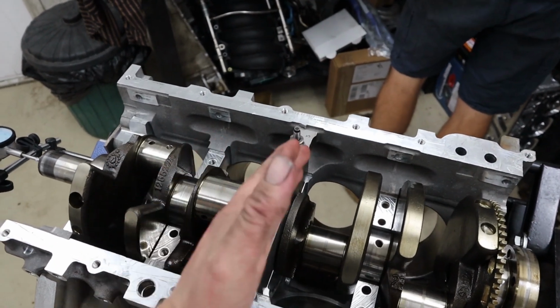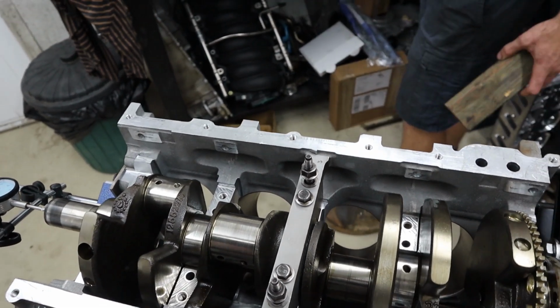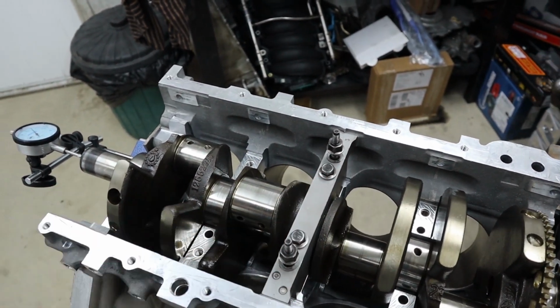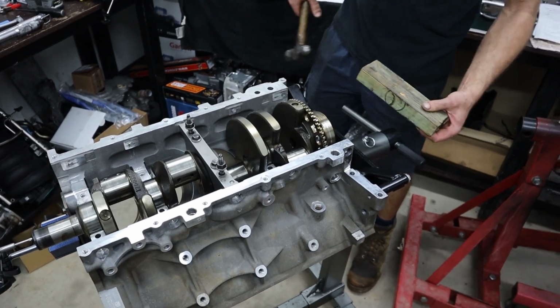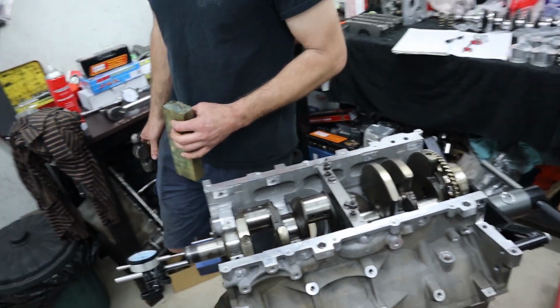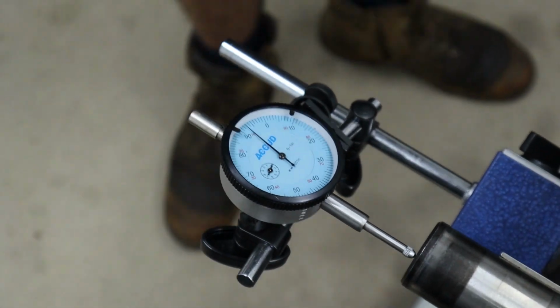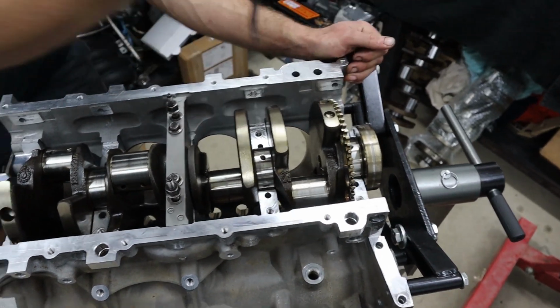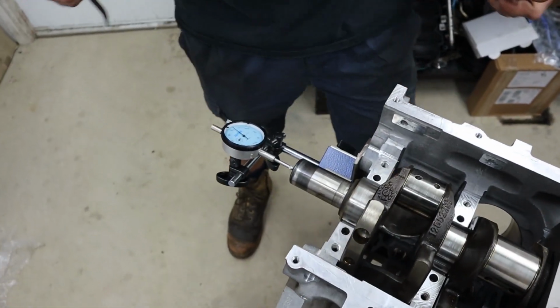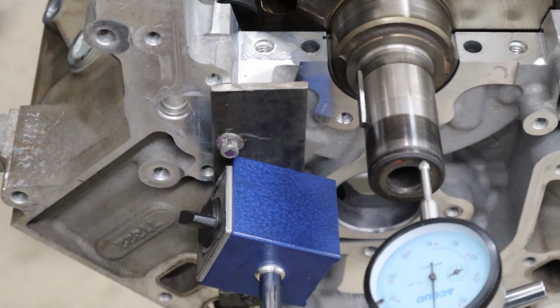So what you need to do is align the two shells in the thrust bearing so that they're straight, because otherwise you can have misalignment in the cap and it can prematurely wear. It looks fairly barbaric, but it's what it do. Cool. All the way forward.